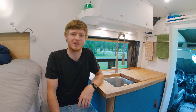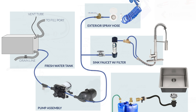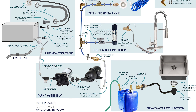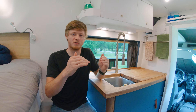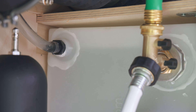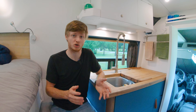I'll put a link in the video description to my website which will have two versions of the diagram: a simpler version and a more detailed version with every plumbing connection and fitting, along with a list of all the components used. One small issue with the tank I used is that due to the fill port location being slightly below the top of the tank, you can't fill it completely before water starts coming out of the vent tube. Similarly, the pump can't draw out the last little bit of water at the bottom, so the actual usable capacity is a little less than the tank's rated size.